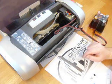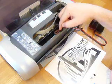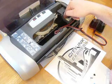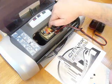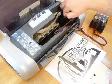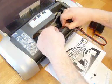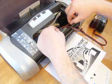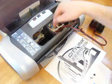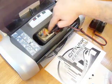So if you need to adjust the ink lines, you can manually push them and feed them through the clips, create more of a loop, and feed some back down here. So they are set at the factory, but sometimes they do need a slight adjustment. So this one, probably a tiny bit tight, so we're going to give it a bit more ink line by pulling it through. There we are, all the way over to the left, and that's perfectly okay,